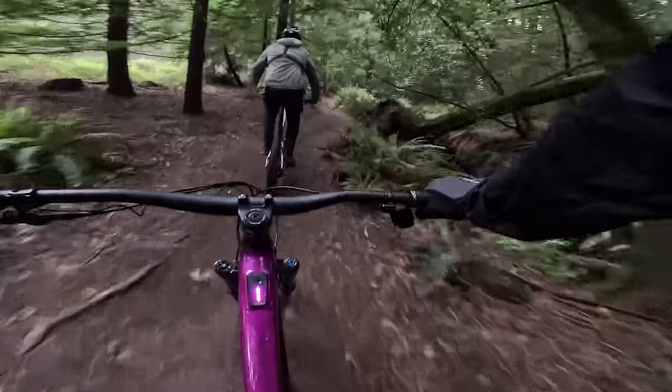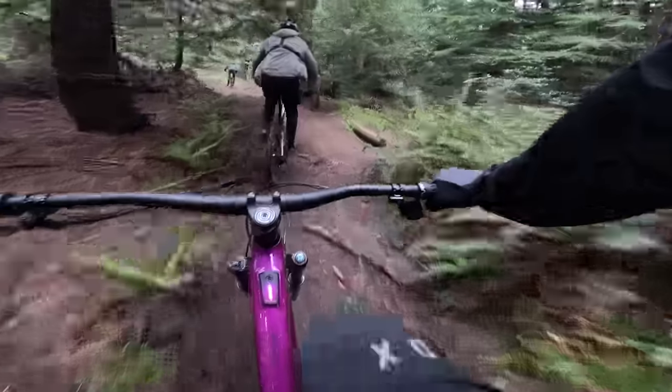Yeah. And I rode this bike, then went on to ride more of the other bikes with the Fazua system on it, and kind of found that it maybe wasn't as natural as I thought at first. I think the power is really good for this size motor. But if you stay in between when you first start your cadence and you don't match the cadence the motor wants you to be in, you end up in this weird bouncing stage where I felt like power was pulsating a bit. You need to either get past the speed you're pedaling at and start matching the motor to be fed that power, or you end up in this weird little no-go zone.